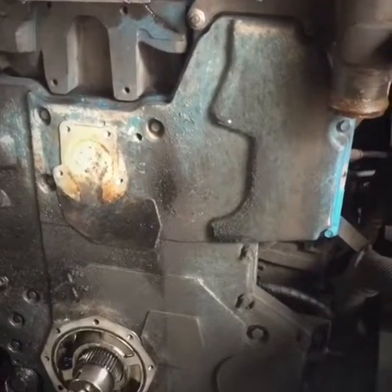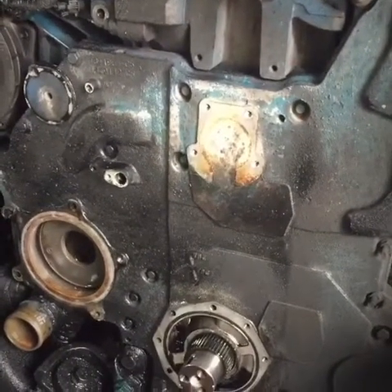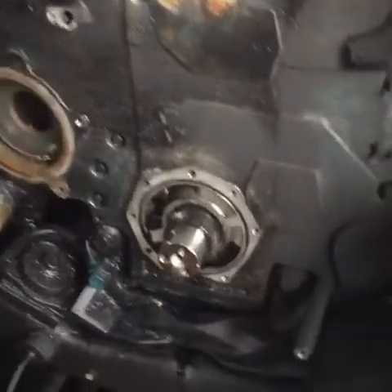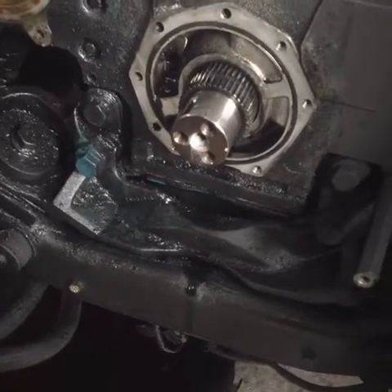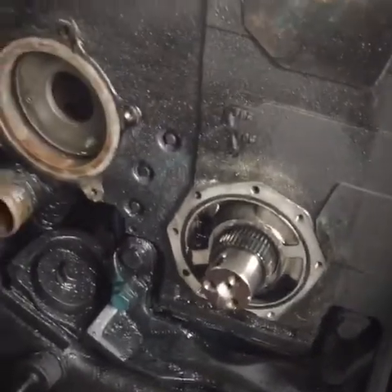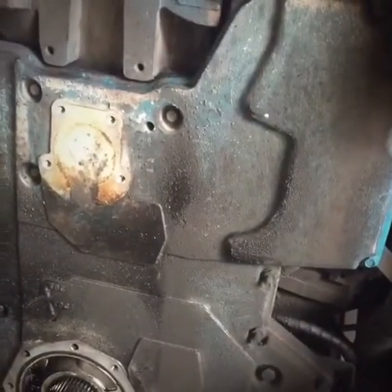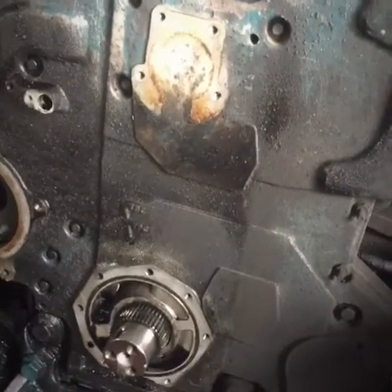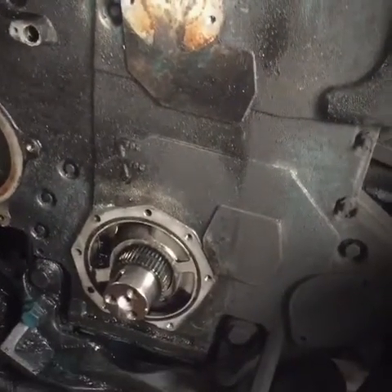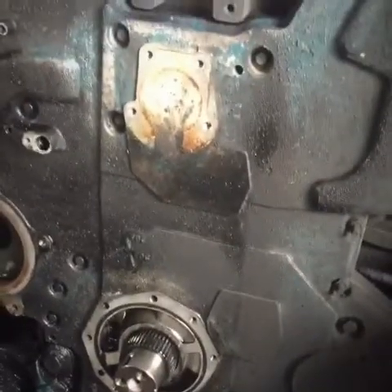Well guys, we're gonna go ahead and stop it here because for the next step I have to lift the engine off of the two mounts at the bottom to be able to get that brace off, unbolt the four screws in front of the oil pan, and then of course all the little screws holding that timing cover in place. I need to get stuff prepped before I can continue, and right now other units are coming in with minor problems I've got to address first.